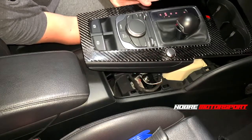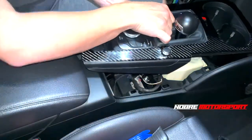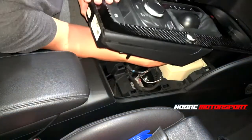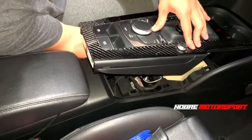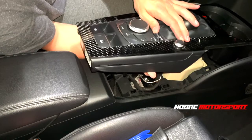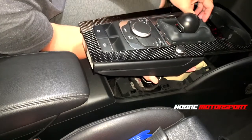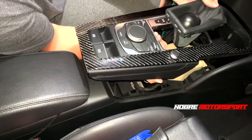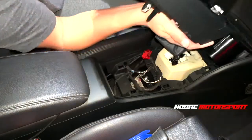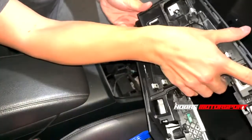As you'll see, it will go out as soon as I unplug it. Lastly, we have the gear shift cable that marks the PRND which we're going to release now. Now we've managed to remove virtually all the trim and we just need to release the trim around the gearbox - this part here pulls up. You're going to pull it and bend it to the side so you can remove the entire center console. I'm going to remove some coins that are here and that's it.